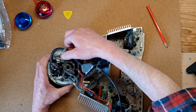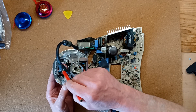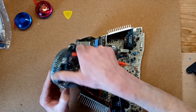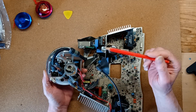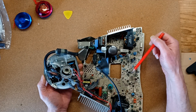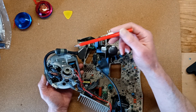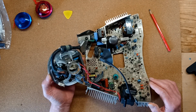There is also the neck board, and the neck board also has some electrolytic capacitors — you might just be able to see those. I can see a couple here; there's three, I think there might be about five or six in here, as well as some tantalums and other things. So really I need to get this metal shroud off the neck board to touch the various cables and actually have a look at these electrolytic capacitors. If I'm going to replace the capacitors here, I might as well do it everywhere else that it needs to be done too.